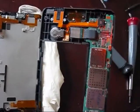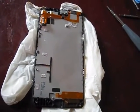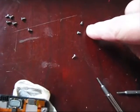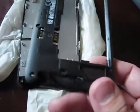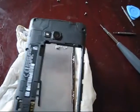You can see the logic board of the phone, the speaker, and the digitizer. The body of the phone is held by those six screws, then those two buttons on the short screws, and the hidden bolt which is located under the sticker. Make sure that you remove it before you take the phone apart.